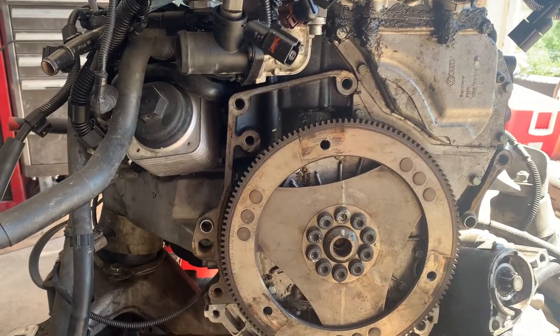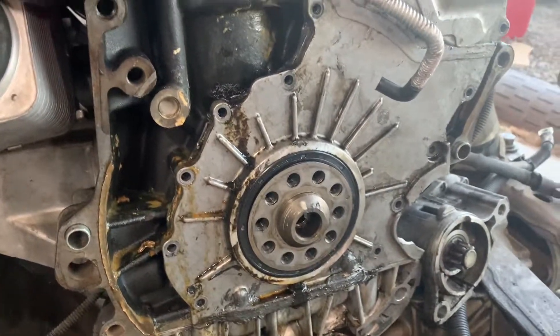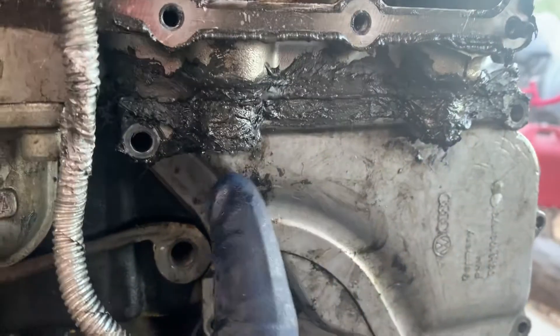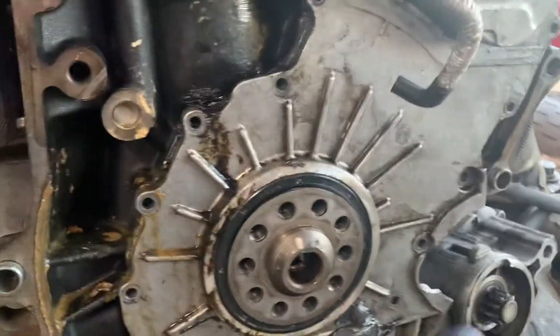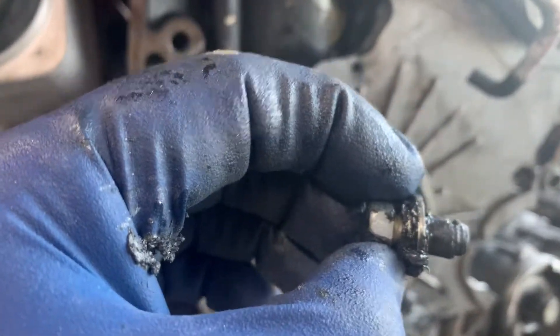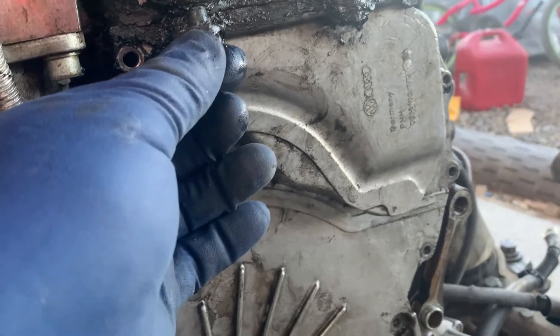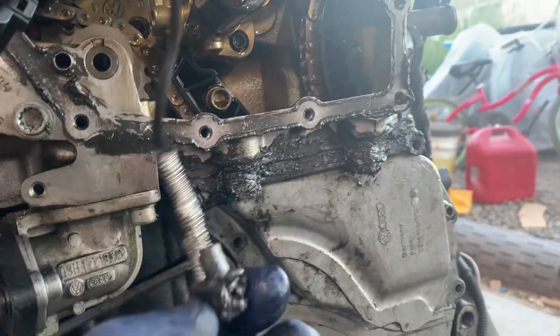So one going into the starter and one coming out of the starter. Definitely don't bolt your starter. Right here — this hole and this hole — where these screws are, there are two bolts like this. It's just silicone. They're either too short, or the wrong ones, or they stripped off the housing. Even if it goes into the drum, the long ones are just held in with silicone. I'm not sure what the purpose was.